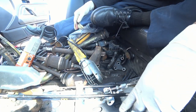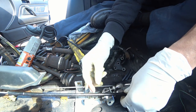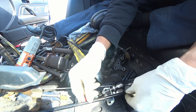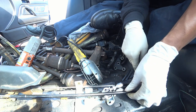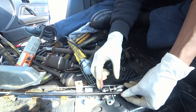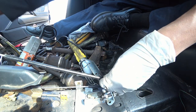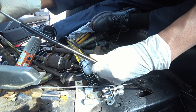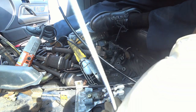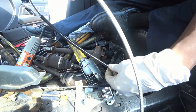This is the setup — this is how the cables are and where they're gonna mount. I've already connected all the cable inside the car, so we just have to cut these to length at this point, basically right here. In order to do this safely, you have to go back underneath the car and remove this section, because you don't want to cut through the casing and the actual cable itself — just cut through the casing.